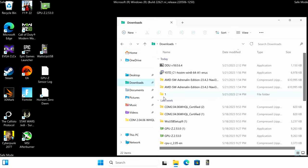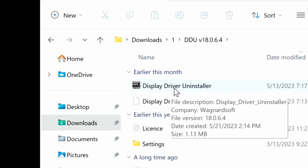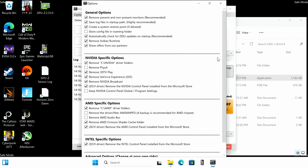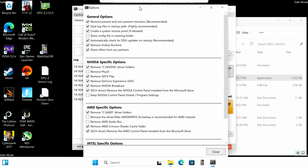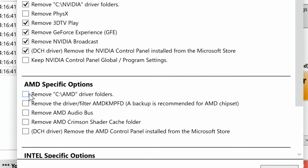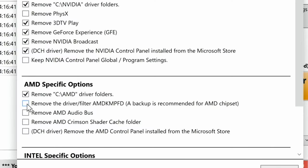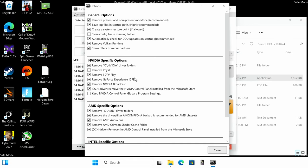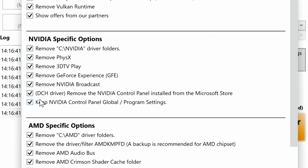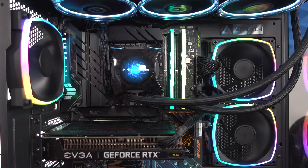In Safe Mode, open File Explorer, go to Downloads, and open the folder where you extracted DDU. Double-click Display Driver Uninstaller. I'll minimize it slightly so we can read it properly. If you have an AMD chipset — meaning an AMD processor — uncheck AMD chipset options, because the AMD chipset uses the AMD chipset driver. This is an Intel board, so the checks stay. Since we have an NVIDIA video card, I'm placing all checks under NVIDIA.